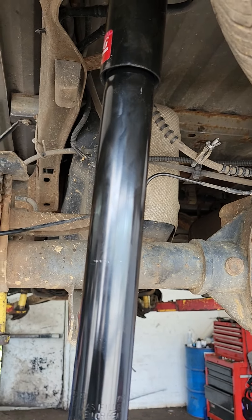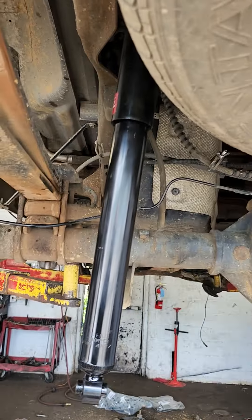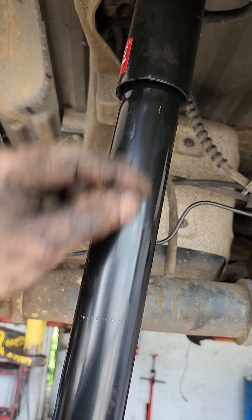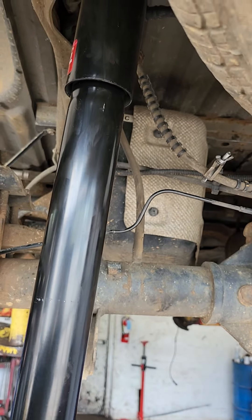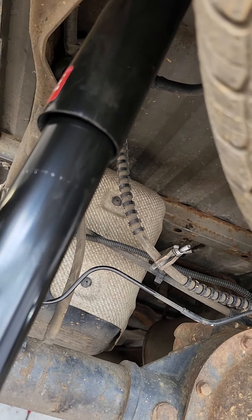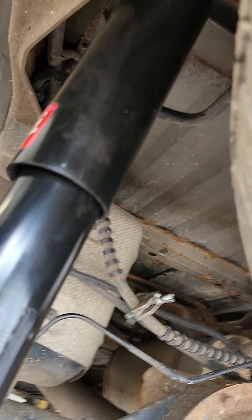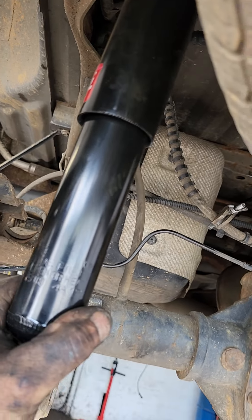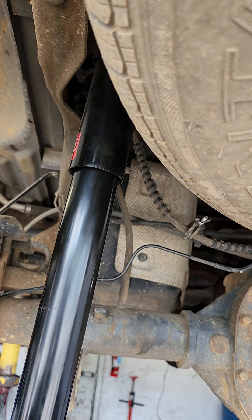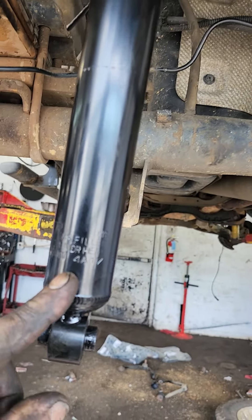This was a perfect way to show you what a good functioning shock looks like. When shocks wear, there's a long piston inside that moves up and down — that's called the stroke. You have compression and rebound, and valving, and every shock is a little different. This should be a very continuous shock, meaning there's no dampening difference throughout its full stroke. There are shocks that operate differently, but they usually have some type of adjustment on the bottom and top.